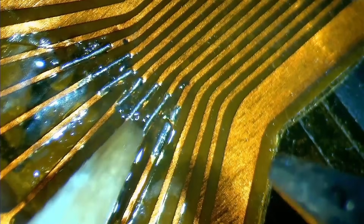What I am doing is to attach the tiny wire to one side first and then reflow the solder while holding it down with a piece of wood. I was quite surprised that this worked as well as it did. The traces seem to be firmly reattached and they should be strong enough to withstand bending to a certain degree. Of course it won't be as flexible and rigid like a new cable, but for the purpose of testing this drive, it should be more than enough. For the last trace, which is clearly a lot bigger than the others, I use the same wire but bent into a U-shape. Because the trace is much wider, more solder is also attaching to the broken trace. This must be part of a power delivery system, so it is good to have a proper connection here.